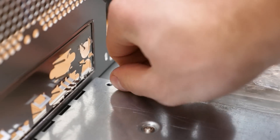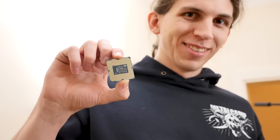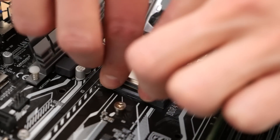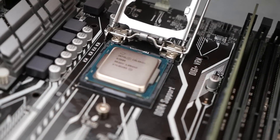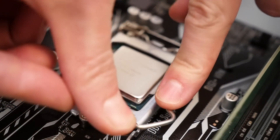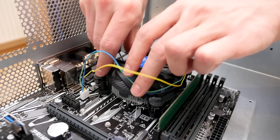The first thing was getting the motherboard into it. As with every case, don't forget the tiny standoffs — otherwise you will short your motherboard — and don't forget the IO shield for the connectors. Then we installed the CPU. A cheap dual core is more than enough since mining only puts load on the GPUs, not on the CPU. We are just using the stock cooler since the space is very limited and the CPU won't run at maximum load all the time anyway.